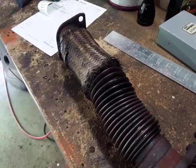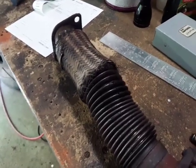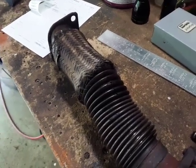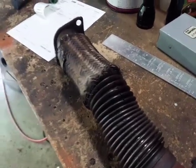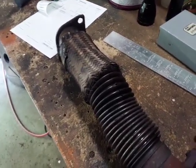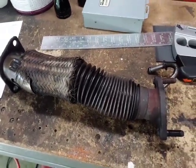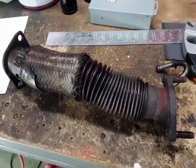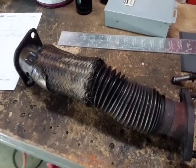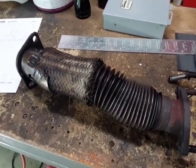They determined that the catalytic converter was plugged up badly. The car has 80,000, maybe 85,000 miles on it, and is using oil, so that makes sense. The catalytic converter is gunked up because it's catching all that burnt oil smoke. The shop told us that it's a California emissions catalytic converter, and they didn't want to mess with it. They've had that happen a few times, and they couldn't get the check engine light to go off. So they sent us to an exhaust specialist, who put an aftermarket catalytic converter on it.